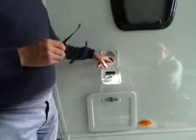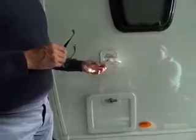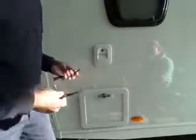Okay, I'll get some keys for this. Oh, I don't need one, it's open. This is your flush tank for your toilet. It's a chemical toilet. So what you need to do is fill this up with pink flush mixed with water, about 30 mil per 10 litres. Whenever you flush your toilet, it flushes round the bowl, and then you empty it into your cassette. There's no gauge to tell you how much is in there. When it's empty, you can refill it.